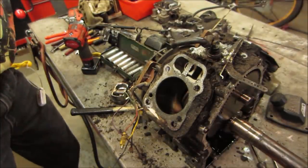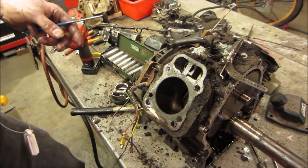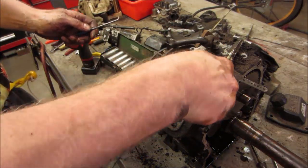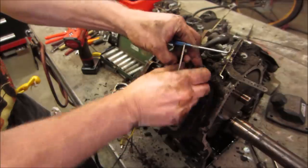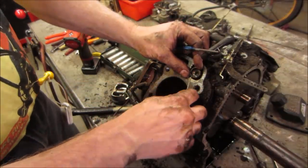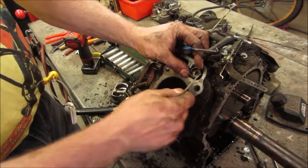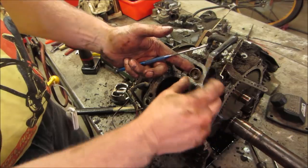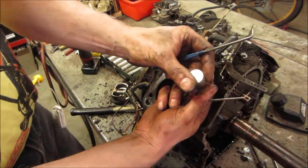I wonder if I had an oil pressure problem. Because that's the side the rod let go first. This one. Still more of it here. So one side probably let go. And then what happens is all the hamburger of debris that's flying around takes the other side out. Plus, I guess this thing was probably running at full speed when it did it.